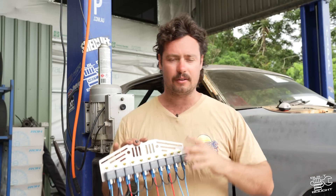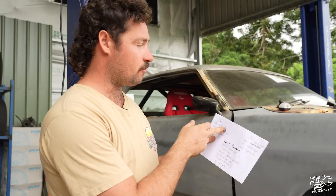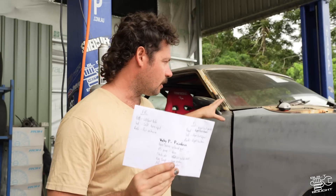The linked earths can basically earth back to the body, then inputs from the switches up on the roll cage from that trailer plug will trigger all of these relays. The big power cable comes from the battery and the output will be all the wires that send to different areas of the car. I've done a little ledger here for each section and corner of the car showing what wires correspond to what switch. For example, one of the rock lights on the front right is the power antenna cable - we're actually renaming the cables that are numbered from the eBay harness and reassigning them. The power steering pump trigger is the horn wire.